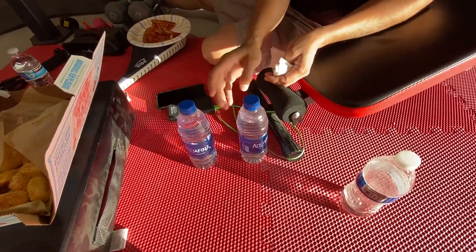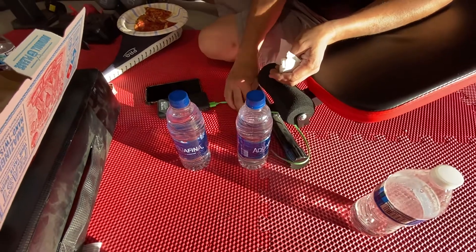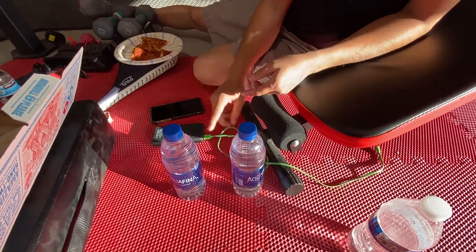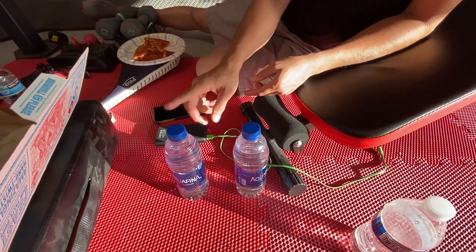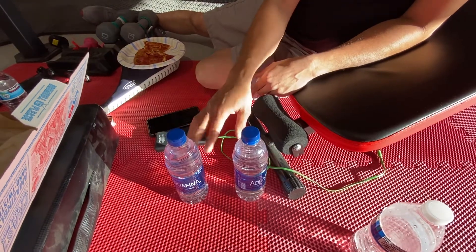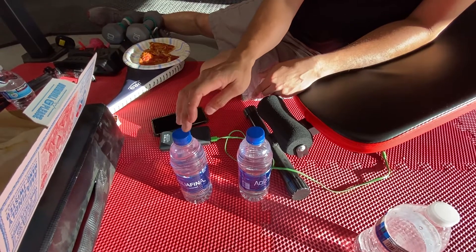The reason why fast charging is bad and good at the same time — it's made for long distance trips where you want to charge up fast, but you can never get it to 100% or maybe even 90%. That's because everything has different cells — different battery packs. Some wheels have multiple battery packs, like a left side and a right side battery. One might be fuller than the other. So if you do a fast charge and this battery already topped off to its maximum, the charger is going to see that maximum and turn off, even though the other battery is not at maximum. With a quick charge, you potentially charge the fuller one first before it gets to the lower one.